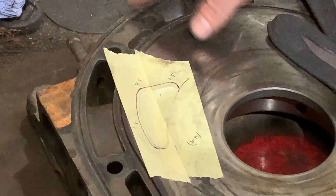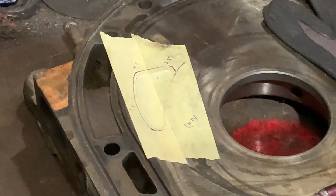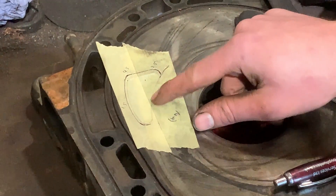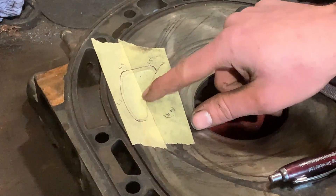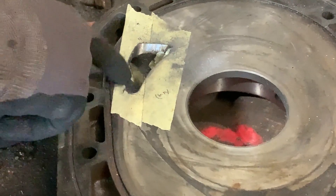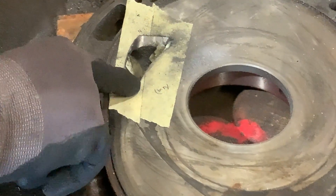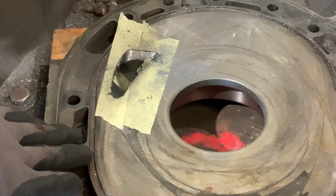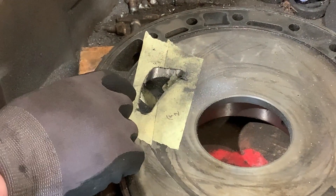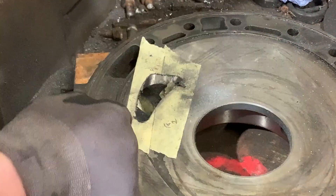It can go a lot bigger up there but I don't want to. I think it'd be fine like this. And here I'm just going to go by 0.2, maybe half a mil maximum, just to get rid of that lip. So we opened the port up to the lines. We're going to clean this up and make sure the port is going to be smooth when we take the mask and tape off. If it's a little bit too small I can always go a little bit bigger, but we'll just see what it looks like first.